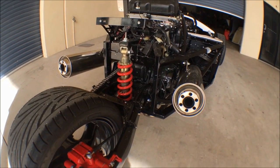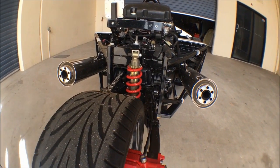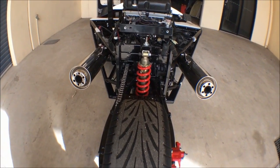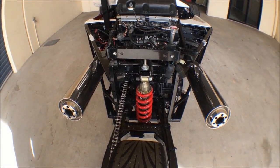It's a design feature that is simple but important, and many three-wheel car designers just don't observe the basic rules of three-wheel car design, which are: make it wide, make it low, make the weight as equal as possible on all three wheels.